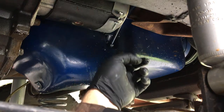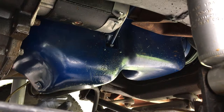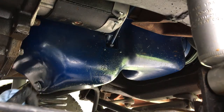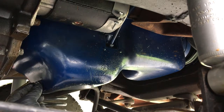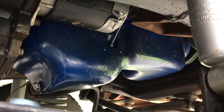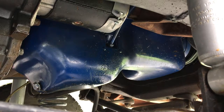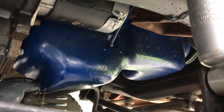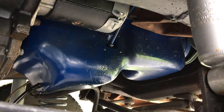What I was looking at is the way it's dripping right down through here - you can see a drip forming right there - and then it blows back on the transmission. With this vehicle the transmission is an AODE; I put it in with the adaptive kit, original transfer case, but I had to buy the electronics brain box to make it all work. I really like the gear ratio and the extra overdrive for running down the highway. The vehicle is not due for an oil change because I just recently put the new oil pan gasket on - went with the more expensive rubber one instead of the cork one.